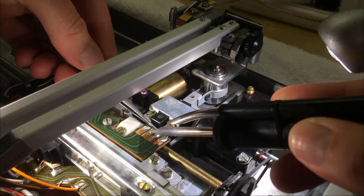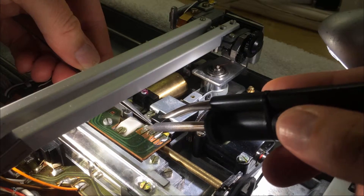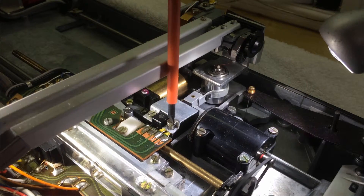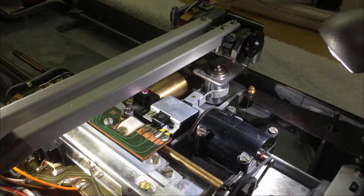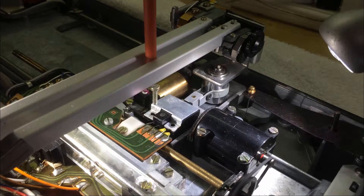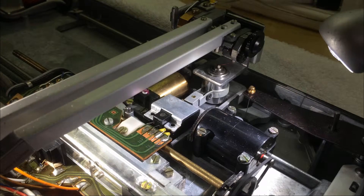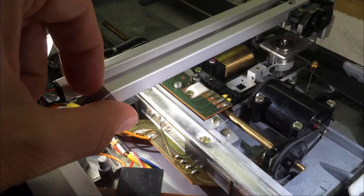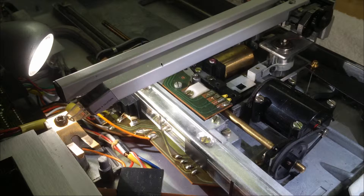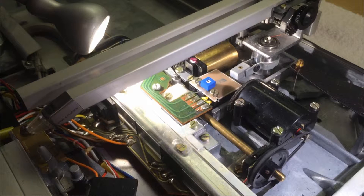First we need to unsolder the leads of the light bulb. Then we can take the screws out and with that remove the bulb housing. Down here this is the aperture, and below the aperture if you look really close you will see two dark slits that have the photo detectors underneath. As the arm moves, the photo detectors see different light intensity and that drives the carriage. Once the bulb is out you can simply put the LED fixture in place, then tighten the bolts and that's it.